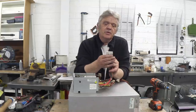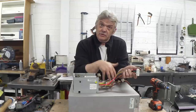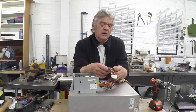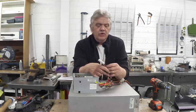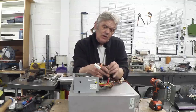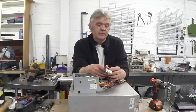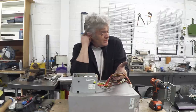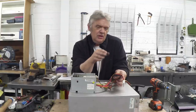There's also a block which was the original pin connector - it's pretty much the same story, with orange, red, black and yellow. Bundle those together with the same colour wires. That'll leave you with a few odd-coloured ones: some blue, a green, a brown maybe, a grey and a purple. The blue wire is minus 12 volts. The brown wire is a 3.3 volt sense wire - just clip it in with the orange wires if you want 3.3 volts out. The green wire is the one you really need - it's the power-on sense wire and you have to connect it to ground, so take one black wire and one green wire and solder them together, and then the power supply will turn on.